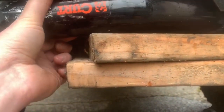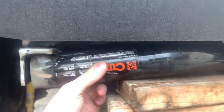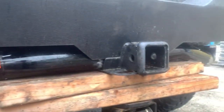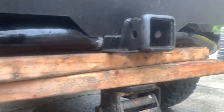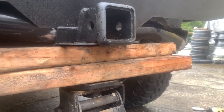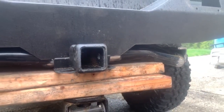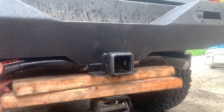I'm gonna tack these in here and go to the main hitch of this cheap bumper. Then I'll take the bumper off once I've got it mounted where I want it, cut the back of the bumper open, and weld this all in properly. I just need to be able to tack in here and get this all set right, then I'll show you guys the next step.